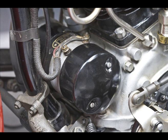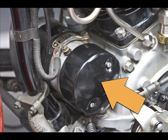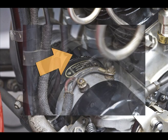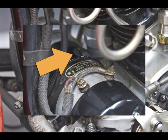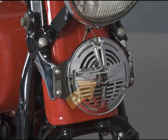Here's the 6-volt generator, the Harley Model 32E, with the black cap on the end and no lock washers under the screws. At the other end, it's held in with hex bolts without slots in. It has the black enamel strap holding it down, this having been cadmium until about 1934. It has the nickel-plated brass tag. This is all correct. The horn has the bar and shield face for the first time in 1936, with 1 year only chrome horn brackets and these chrome or nickel bolts.